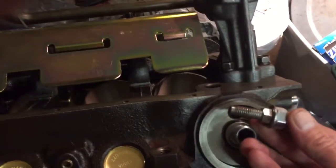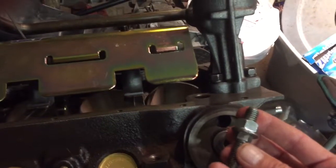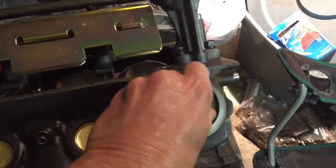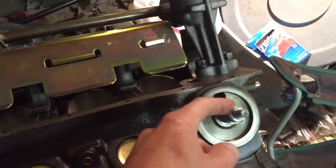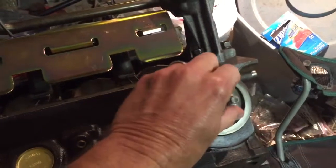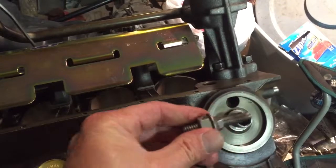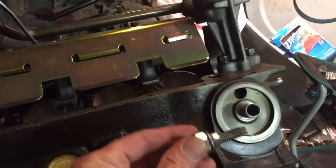But this is an old bolt, and I had to shave the head of this hex here such that it would fit down inside, and then I used a wrench basically to just screw it on. Now I couldn't take it back off that way unless I got a second nut to deadlock this nut. But anyway, good enough to get it on. I put a little bit of Loctite on it because I want the filter to come off, not the insert to come out. So if you have that little challenge, I think this came off the motor mount on this motor originally. It was in my stack of parts that came off, and so I made use of it that way.